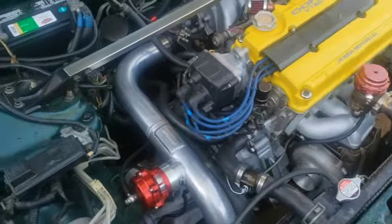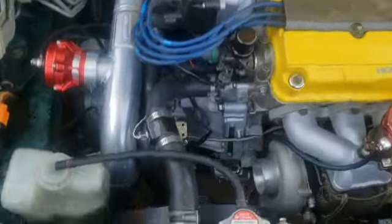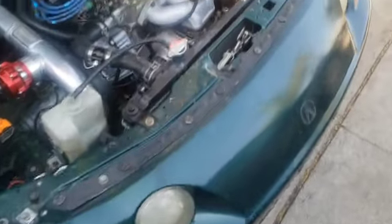Because of all the motor mounts I have, I shake stuff loose. I know it's doing something with the shifter, which I'll show in a bit. I have all new mounts all around — both torque mounts are new, with solid bushings. I also have my Innovative mounts all around, and I finally put the rear one in, which I didn't have before. All the bushings are solid so it shakes the car a lot.